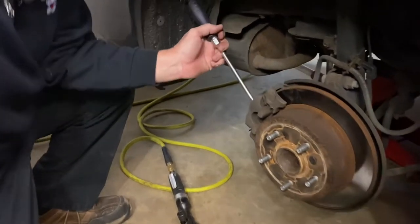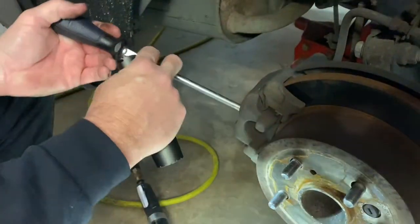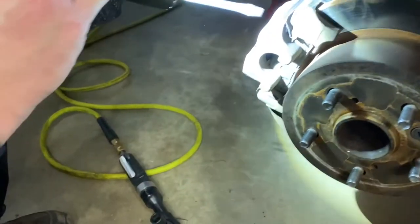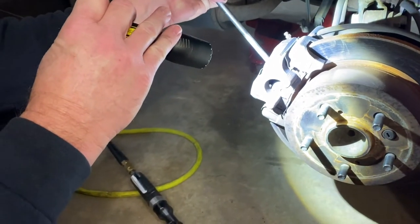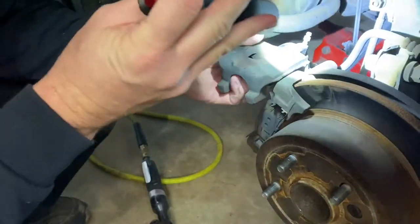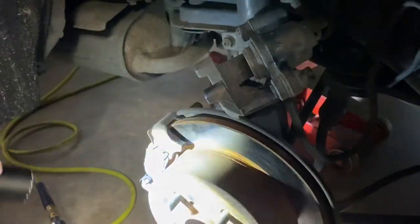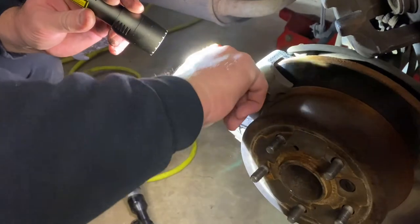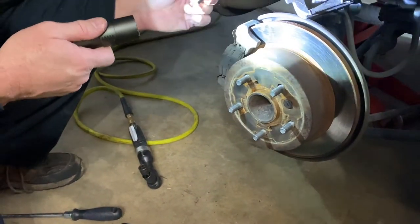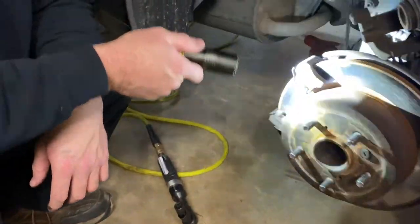I'm going to get my little flashlight so I can see what I'm doing. I'm going to pry this back just a little bit and squeeze the caliper back, then I'll finish it off later. I'm going to pull this on up — and you see how it slides on this front pin here, just like so. We'll go ahead and lay this out of the way, then remove these pads. There's the inside pad and our outer pad right there. I'm going to lube up a couple points here and we will get this put back together.